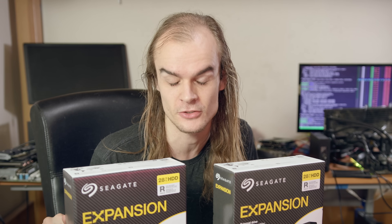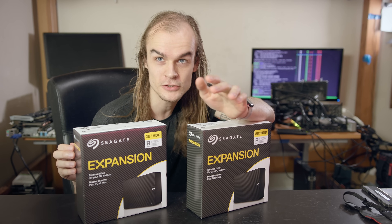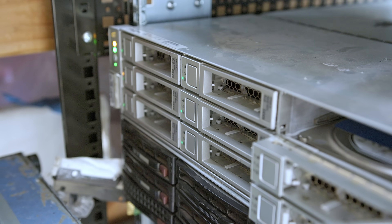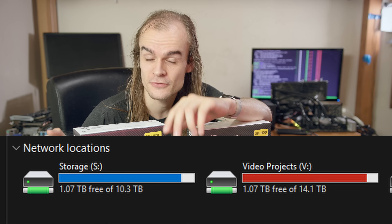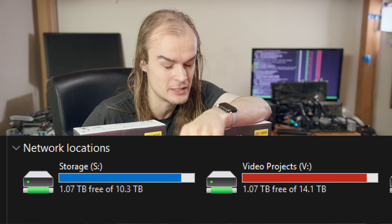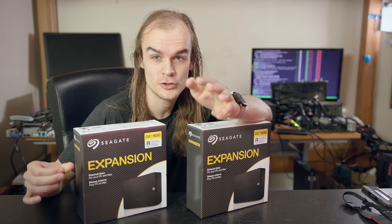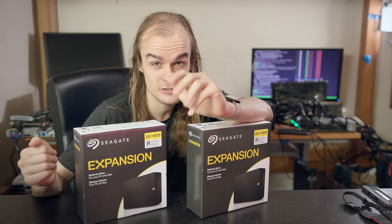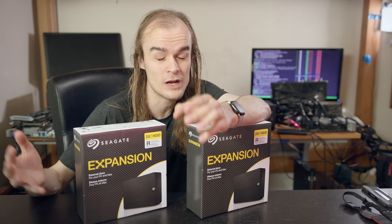Or if maybe you should just look at the actual NAS rated drives and not try to save a buck. My main home server has six 8 terabyte drives in essentially a RAID 5 or RAID Z1 configuration, and I have effectively filled that array. I'm at about one to two terabytes free, so I am well past the point where I should probably buy more drives. I also have another server with roughly 30 terabytes of media that I've kept off to save power.